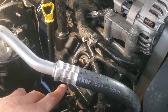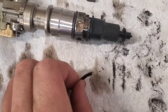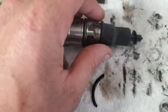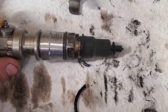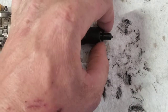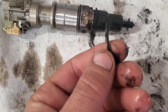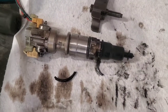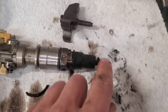I pulled this wire right off and cranked the engine — it's definitely fuel. We need to get this valve cover off and pull out the number one injector. The cylinder numbering on this side goes 1, 3, 5, 7. Now we know the engine cranks over. We've got our confirmation here — the o-ring seal is damaged. Your fuel comes in right there, and without that o-ring, this injector may not have been torqued down properly, because it's not supposed to look like that. You can see combustion has gone past it and disintegrated the o-ring, which allowed fuel to spray into the cylinder and hydro-lock the engine.